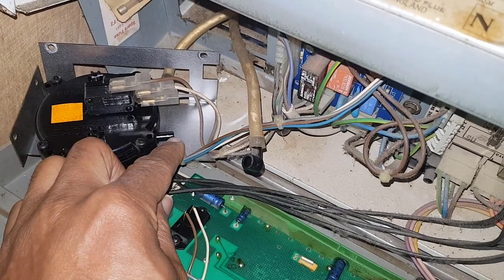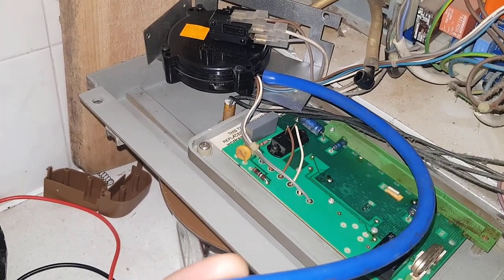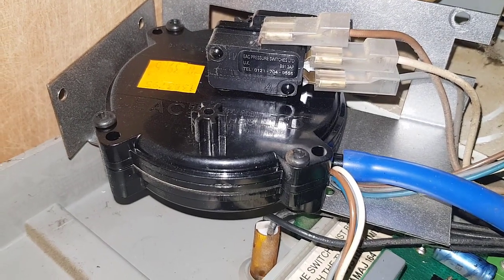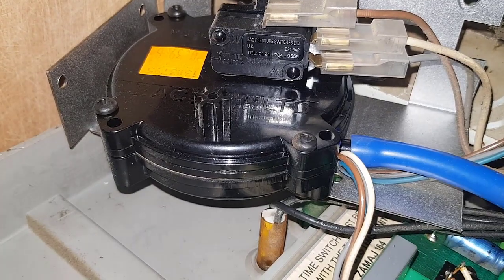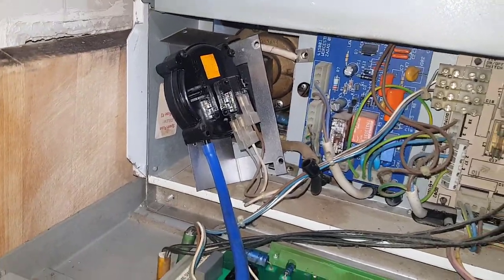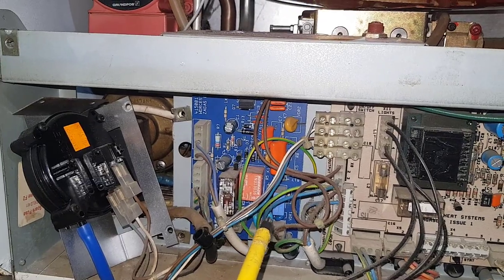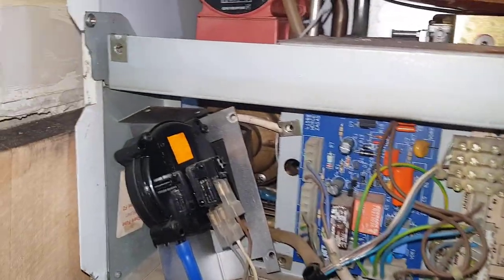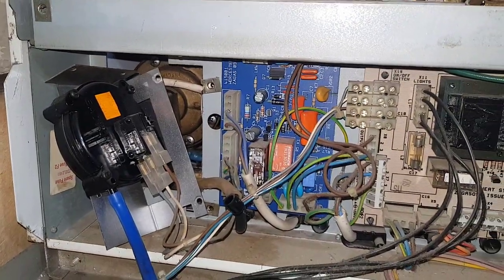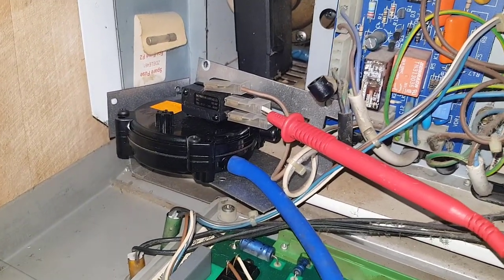What I'm going to do now is put a normal tube on this one and see if I can hear it click. So I've put my tube on it and given it a blow — and we are getting some movement now and it's making a noise. So there are two possible things: it's either the air pressure switch or this ignition board, because there's no power going to the fan. I tried sucking on it — it clicked but still didn't work. So as I said, it's one of these two components.